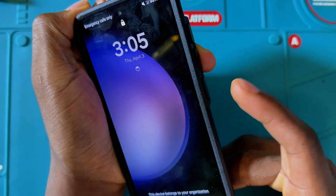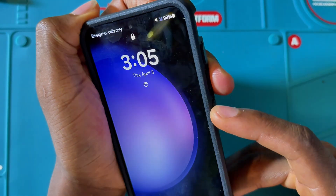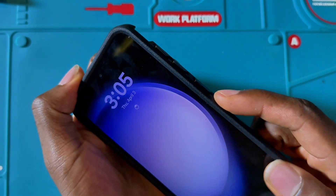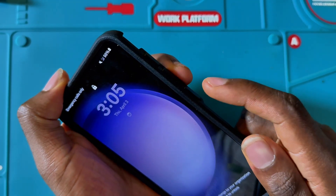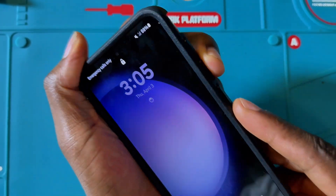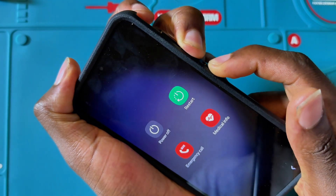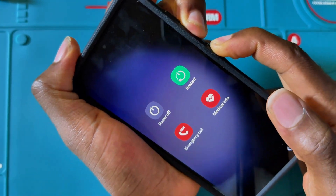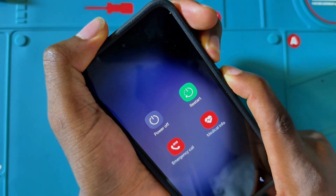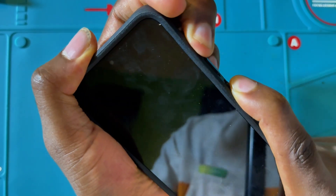What you're going to do is press and hold the volume down key — you have the volume down key here — and also press and hold the power key at the same time. Press both of these keys at once. When you see something on screen, don't worry, just keep holding the keys. Once the phone goes off, release the volume down.